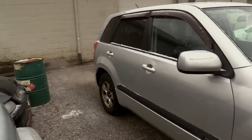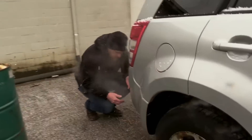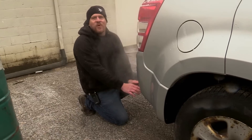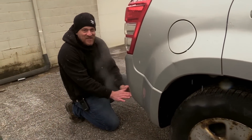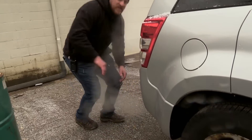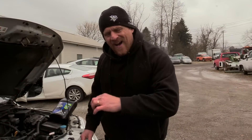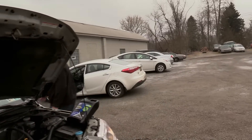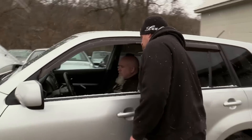There is some smoke there — we could actually go take a whiff of it too, just use our nose and smell it. It does not smell like coolant, just a typical exhaust smell, nothing crazy. Cooling fans are on right now and it's cold air — that's not right. What's the temp gauge? Not hot right now. My cooling fans are running and they really shouldn't be.